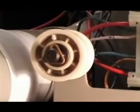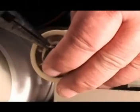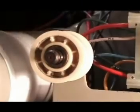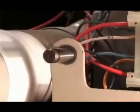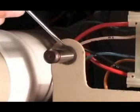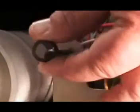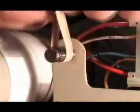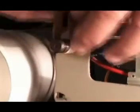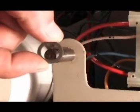You could use the needle nose pliers to remove the plastic triangular stop ring from the idle pulley wheel. Remove the wheel. Remove this fiberglass washer and check it and make sure that it's in good shape. Use sandpaper to clean the idle pulley wheel shaft if you need to. If the fiberglass washer is good, go ahead and install it.